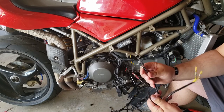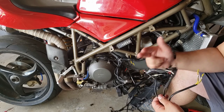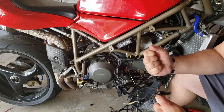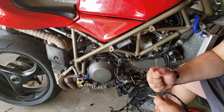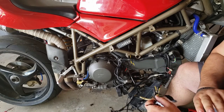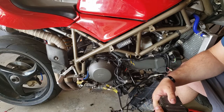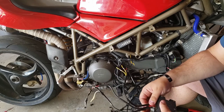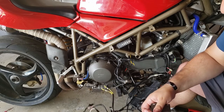because it's handy. So off of the battery, I did it probed, and then I just cut the wires again because the probes were a little sticky, and I stuck the probes right into the end to see if I got a direct current. And again, I got jack squat off of the new regulator. That tells me I'm two bad regulators in a row. That's where we lie today.